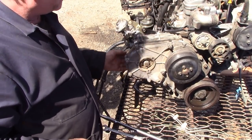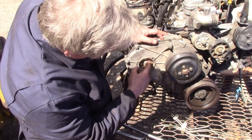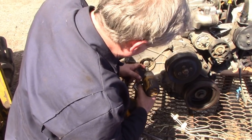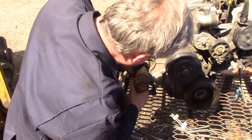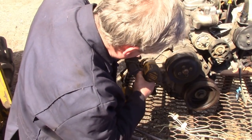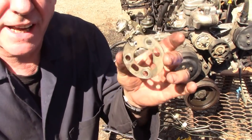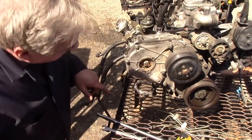Now with the cover off the injector pump's ready to come off - except for the bolts holding it to the body. We can see in here there's three bolts. What we're simply going to do is take them off. Don't mix these bolts up with any others. If you're clever and don't drop your socket on the floor, take that ring out - now we've got access to the pulley.